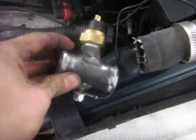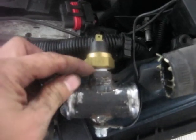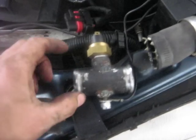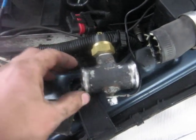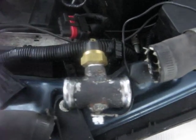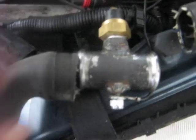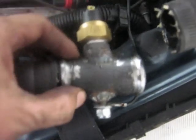You can see it there — it screws into a pipe fitting, regular pipe thread. My son made up this adapter, I guess you'd call it, out of a piece of steel pipe and welded on each end. A little nub there so that the pipe will grip it. Then we slit the regular rad hose, took a piece of it out, and hose-clamped it in there.